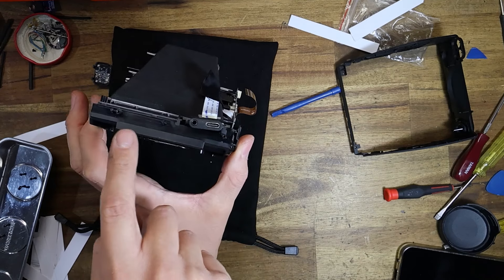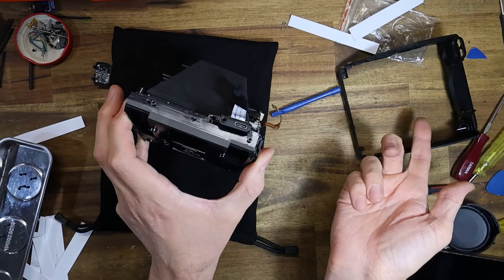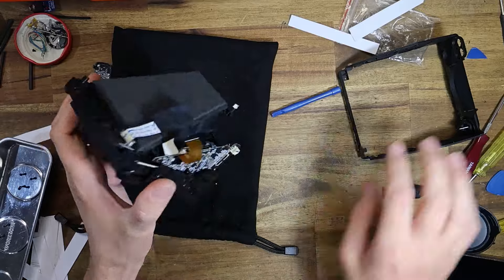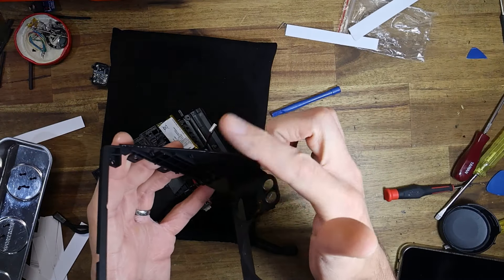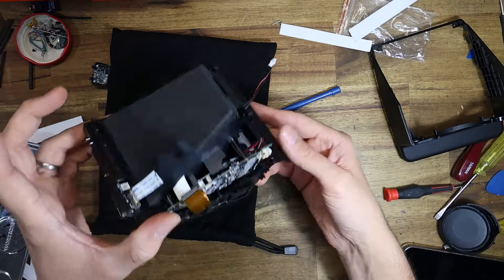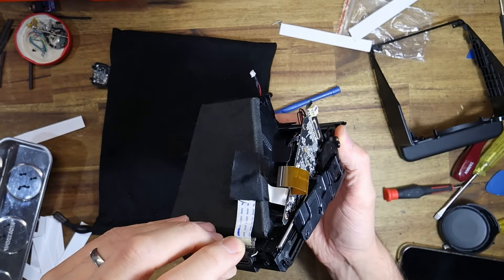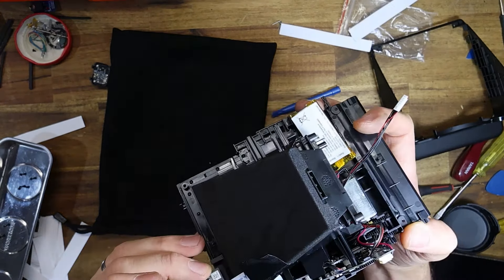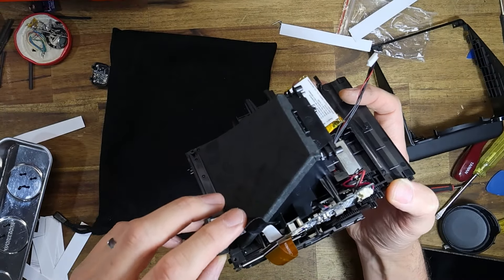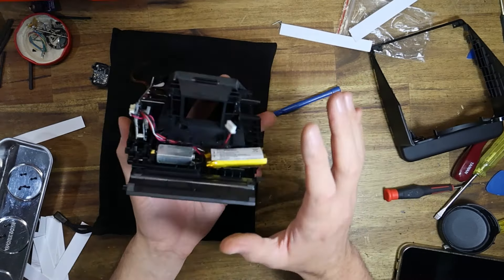There were also cases where there were plastic clips where there should have been screws. I'm going to snip those clips off because they don't need to exist — it'll make reassembling this thing in the future way easier. I'm also contemplating deleting a few of the back clips too, because it's so over-engineered in how it goes together that it's really not user-friendly to repair at all. I say that as someone who fixes Polaroid cameras all the time — this thing is on another level of difficulty.